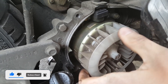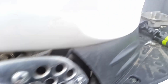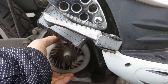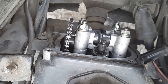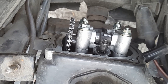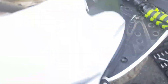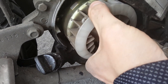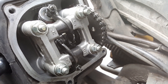Now let me show you what it looks like when it's wrong. We still have the T lined up but the hole on the camshaft isn't visible. And when you wiggle the fan wheel the valves move too — you can see the intake is moving. That's not the right position. So I will turn the flywheel one full rotation and check again. And now it's correct.